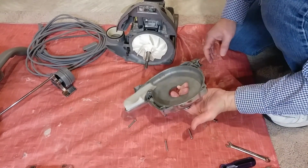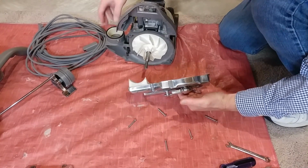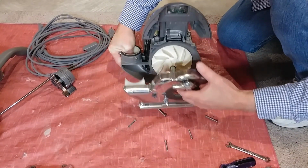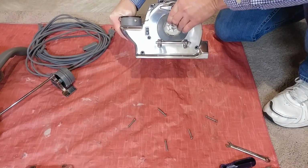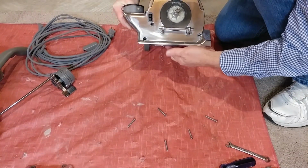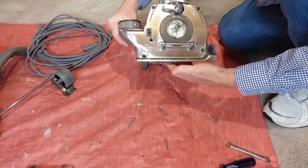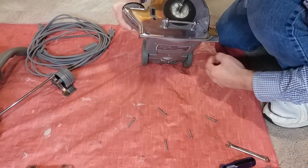But I have now, with 8 Kirbys, tested this as far as particle count and airflow losses, and I don't have any. So at this time, I won't be putting any gasket material on there. Now, Kirby does not recommend that, so don't do that. I don't use it because I haven't found it to actually be necessary.